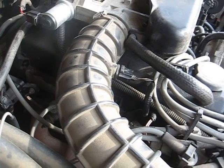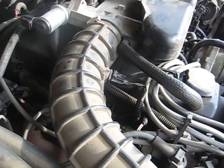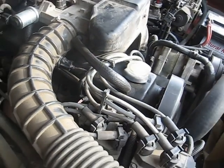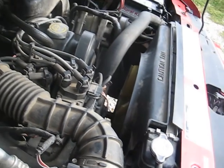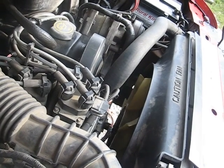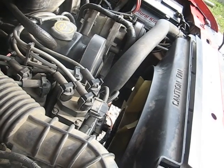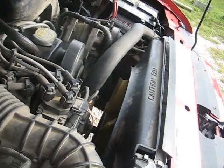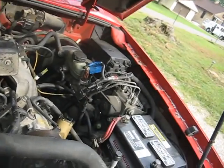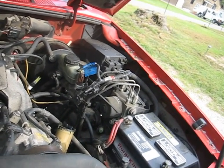Plus on all four wheels — this is a four channel system — it has a wheel speed sensor on each one to control braking. This is the same for 96 to 01 2.5 and 96 to 2010 2.3. The only thing that's different is maybe a slight change in location, but they all have the same sensors. I hope this helps. If you have any questions, just let me know and we'll see you next time.